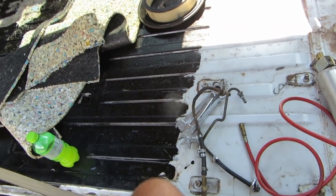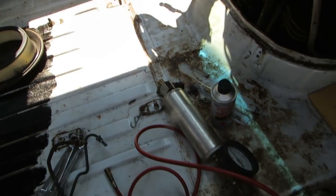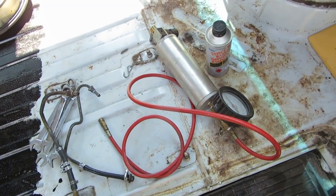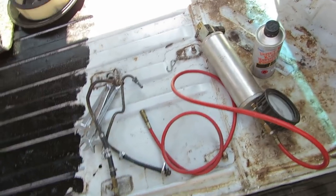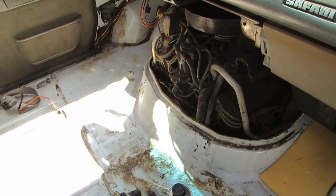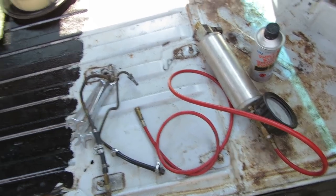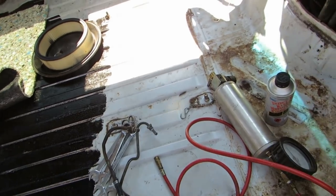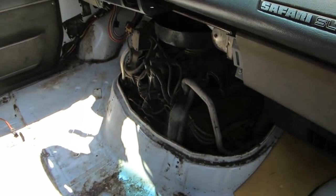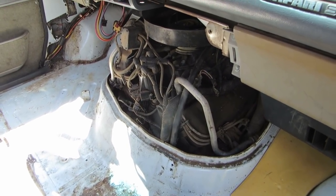Now, don't just put the cleaner in there right away — if you put the cleaner in with pressure, it'll spray out all over the place and maybe catch the engine on fire. So you first put a little gasoline in there and run it on gasoline to make sure everything is sealed up and working. You gotta go through these steps in order. Let me take my air cleaner off and get to the TBI connections.